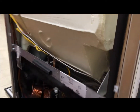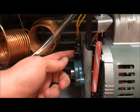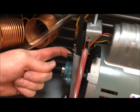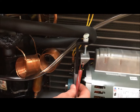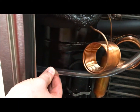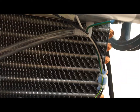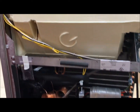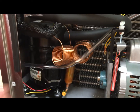Next, we're going to check our motor. You have a pin sleeve — this rubber boot — make sure that it is intact and not damaged. You also have your micro switch; check to make sure that is in proper working order. Check your bearings to ensure they are secure and stable. You also have your tension spring — make sure your coils are in a nice tight pattern. You have your clear overflow tube; if there's any debris or product built up in here, that means your rear shaft seal was bad. Rinse the hose out with warm soapy water. It could also be a sign that your shaft seal was installed backwards.